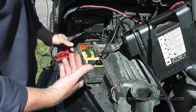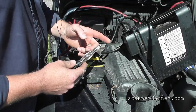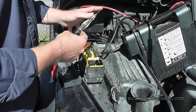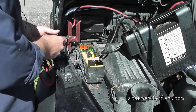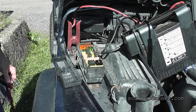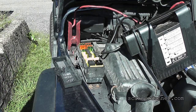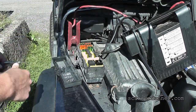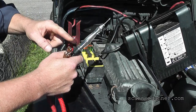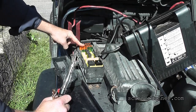But that doesn't address why the yellow wire doesn't have power when I'm cranking. We have two problems here and the ignition switch is new. Maybe I'm not contacting the yellow wire right — you saw me poking holes in the wires. I don't like to poke holes in wires but sometimes you have to. Could that circuit be shorted to ground? If it was, my test light would be lit when I went to battery positive on that yellow wire, and it would blow that 40-amp fuse. That's not the case.